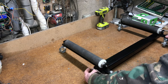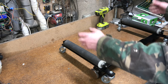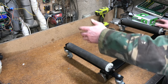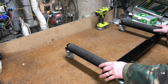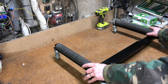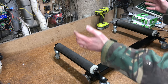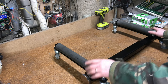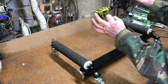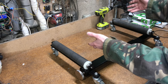It's not moving very quickly but you'll snug that into the wheel, whip your five nuts off, and the wheel will be resting on here. You can pull this away — it's fully wheeled as you can see. The wheel will come away from the hub. You do your work on the Land Rover or any other vehicle with big wheels, then slide that back in roughly in the position where it needs to be refitted. Because these are on rollers, the wheel will tilt slightly or rotate 360 degrees. Once in position you can turn your wheel, line up the studs to the holes, and if you haven't altered the height it's virtually straight on.